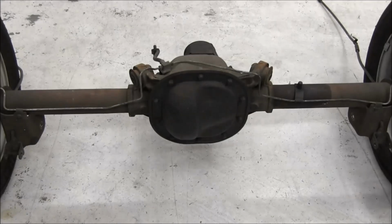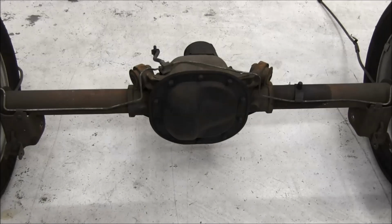The upper control arm bushings pressed into the axle housing of 1979 through 2004 Mustangs will eventually require replacement, either because they are damaged or because the rubber has degraded due to age. This axle housing came from a 1988 Mustang. While removing the housing from your Mustang is not required, having it out does improve access.